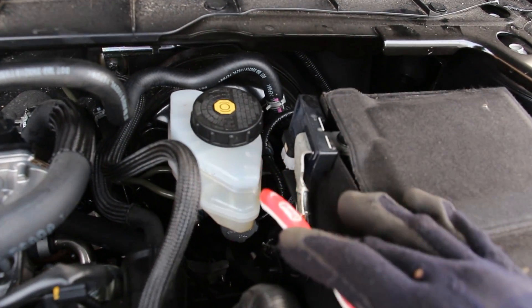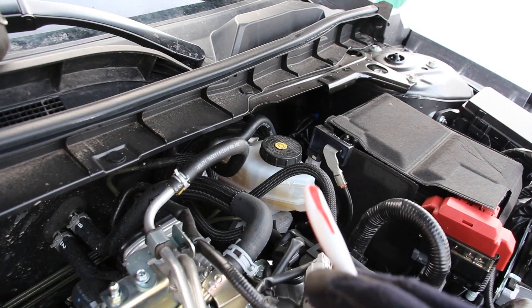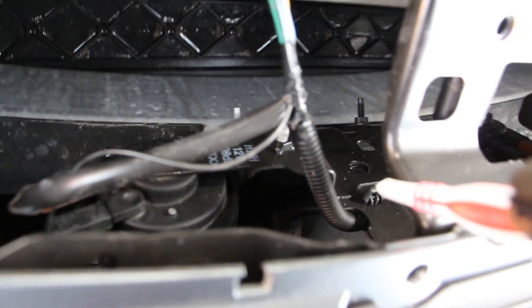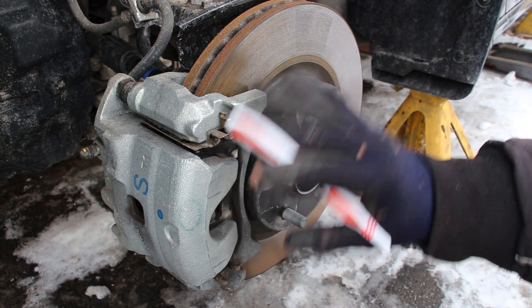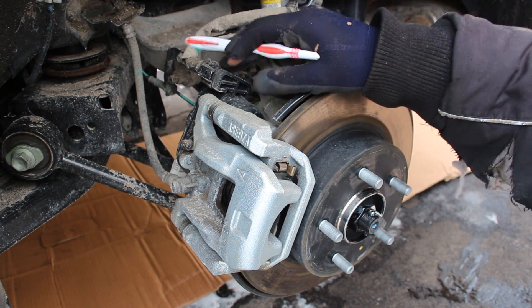The Altima uses a traditional braking system with the master cylinder located here powered by a brake booster. That booster gets its vacuum directly from the intake manifold, but on turbo models there's a vacuum pump that powers it. The master cylinder then sends its lines down to this ABS module which controls the ABS, dynamic control, as well as the autonomous braking features. Speaking of autonomous braking, we have the radar sensor built into the front emblem on the front bumper. The brake pedal has two sensors — one is a stop lamp switch and the other tells the computer how much brake you've pressed to activate the brake force distribution system. At the front we just have a simple single-piston floating caliper on a disc brake. At the back we also have a single-piston caliper on a disc rotor, however the parking brake is electronically actuated through this motor here — and this wire here has a lot of crust on it which could cause issues.